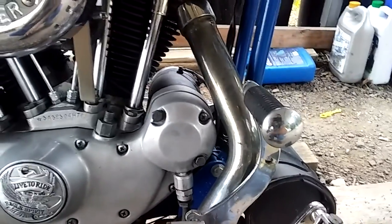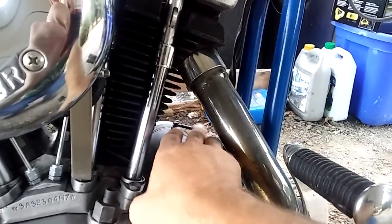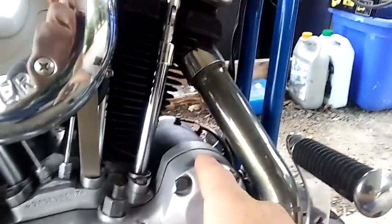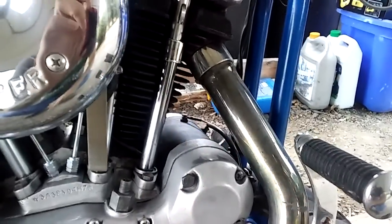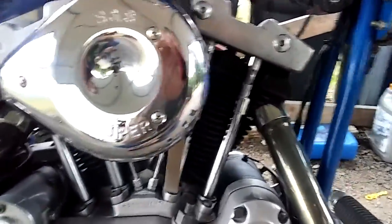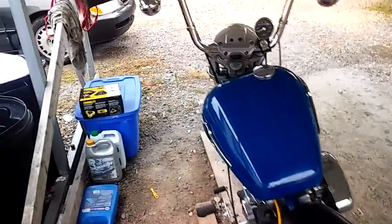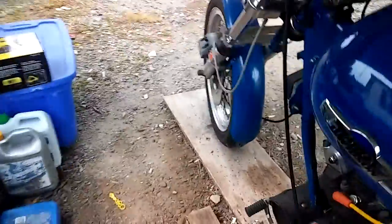it back up. Or you can also just disconnect these 2 particular leads down here, which I'm on this side of the bike, so I'm just going to show you on this side. You can remove those 2 particular leads and remove your regulator leads, and your battery should stay charged all winter. Now, contrary to popular belief, let's say you got concrete. Well, most people seem to think that putting a battery on concrete will drain it. That's an old myth. That's actually been disproven a long time ago, but some people stand by it, and that's fine.